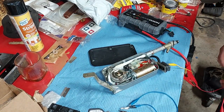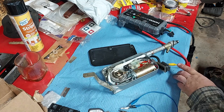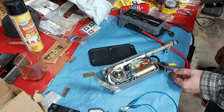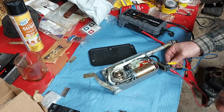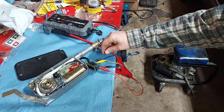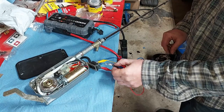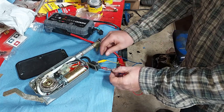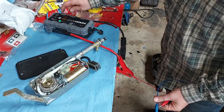The way you check these out: you hook your negative battery terminal or ground up to pin three, and connect your power to pin six. We're going to go ahead and jump to another pin. And we can see — that works. So this antenna is actually working fine.